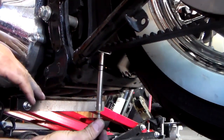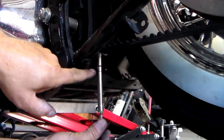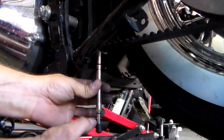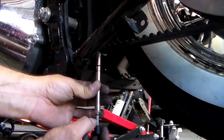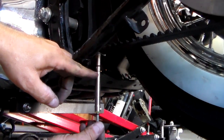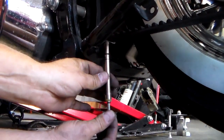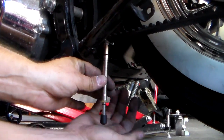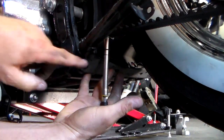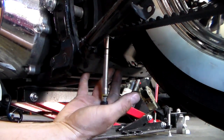As you can see, if I put it on there and I push up just a little bit until I start getting a little bit of tension, my black O-ring is right at the top of that cross member. Then I'm going to push up until my O-ring reaches the 10-pound mark. At that point, when I'm holding it there, my drawn line — which is 5/16ths to 3/8ths inch — should end up at the top of this cross member where this O-ring initially started. So we're going to do that. Push up — there's 10 pounds and my mark is exactly where the O-ring was. So my drive belt tension is exactly the way it's supposed to be at this point.